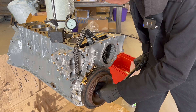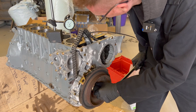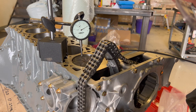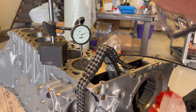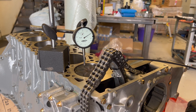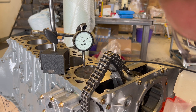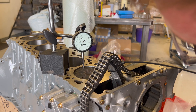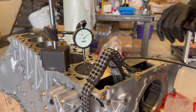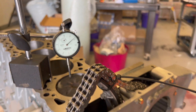It's at three millimetres, so we're going to go — that's point one, that's point two. Now don't overshoot point three like I just did — I just went to four. Just pull it back a good amount and then go back again. Don't be tempted to just tap it back. There — that's three point two three.